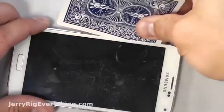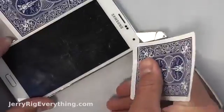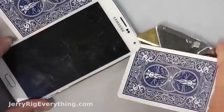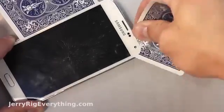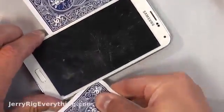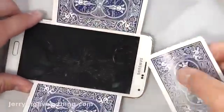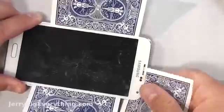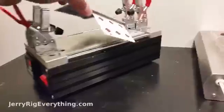I'm not going to go too deep into the phone just yet because there are two important ribbon cables inside of there, and if you go too far you're going to rip them. Make sure to watch farther ahead in the video to see where those ribbon cables are and make sure you avoid them, because if you do rip them you'll have no option but to buy the more expensive part. I'm leaving the cards in there as I slide them in so that the phone doesn't re-adhere to itself.